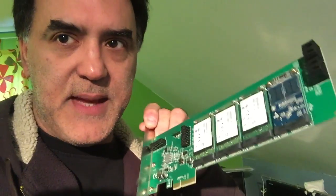Why might you want mSATA and SATA together? It's capacity and price: you can buy a 2 terabyte SATA drive for under $100, versus a 256 gig mSATA for roughly $100. So if you can get the capacity and the speed — even if you just double the speed from 1.5 to 3 gigabits per second off this card — that would be phenomenal. That's what we're working on and I'll keep you posted. From IDX, thanks for watching — please rate, subscribe, tell your friends. Till next time!